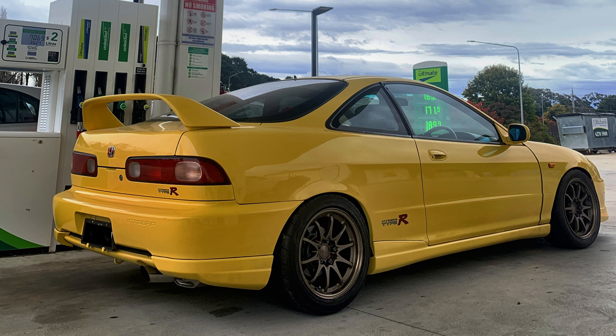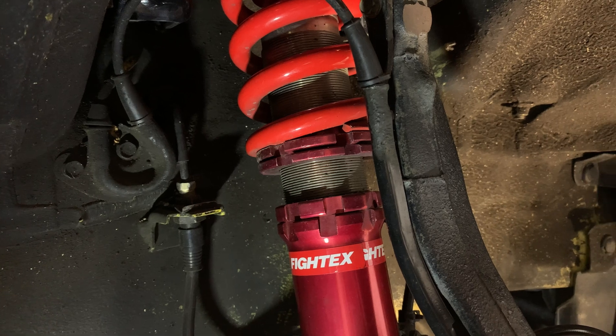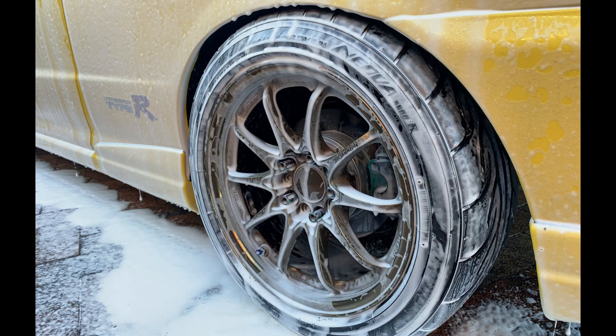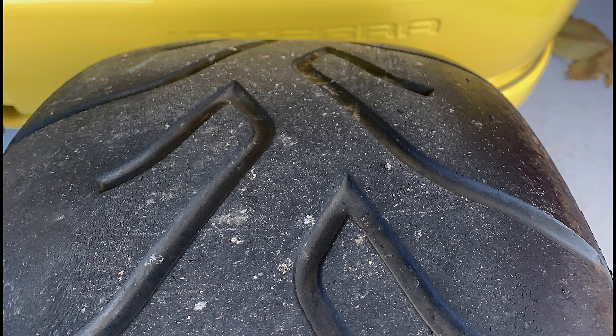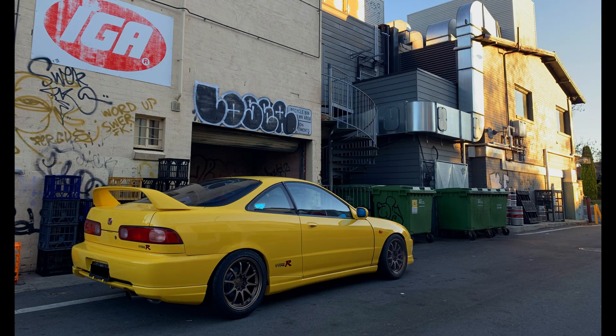This means the top of the tires tilt inwards quite a bit compared to what I'm used to. The front tires have wear on their inner edges, and the outside edges have no wear at all, as they don't touch the road. The combination of low ride height, firm coilovers, 22 offset wheels, wide semi-slick tires, and an aggressive wheel alignment might work well on the track or Instagram, but when I'm cruising down the street, the car tram tracks and bump steers erratically.